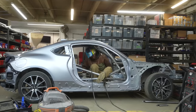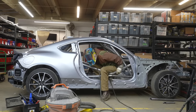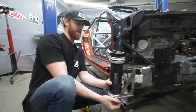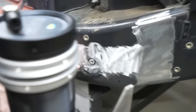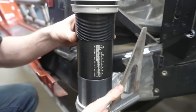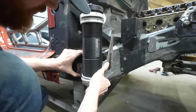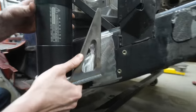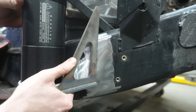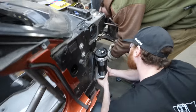Hey Cam, don't get too comfortable. Gotta love when you have employees. So I have this mark here and this mark here, and we're going to line up those two points best we can. And we're going to tack this lower corner, because if I tack the lower corner I can still move it and I can still get it level. Bottom corner, please.